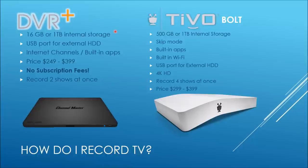So we'll go ahead and break down the Channel Master's features and perks and things like that. First of all, they have two different models. They come in either 16 gigabyte or 1 terabyte internal storage. Now, 16 gigabytes is relatively useless when it comes to recording HD video because you can't even really record an hour show on that. You're not going to get much in the way of recordings at all. Trust me, you aren't. So with that said, they were luckily smart enough, the engineers over there, well, somewhat smart. They put a USB port on the back and the capabilities of connecting an external hard drive in which you can connect 1, 2, 3 terabytes. I don't know what the limit is, but in a sense, you have infinite storage capabilities because you can continue to buy external hard drives relative to the amount of recordings you have.